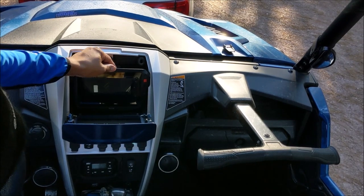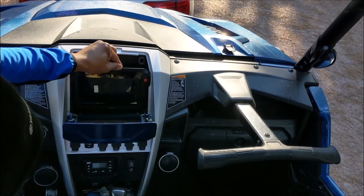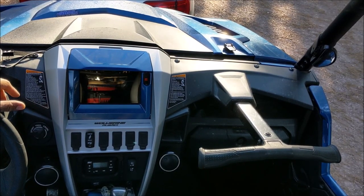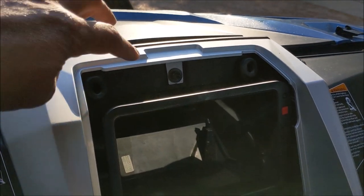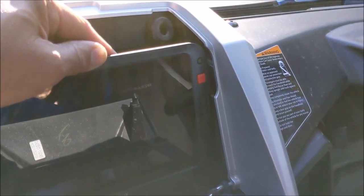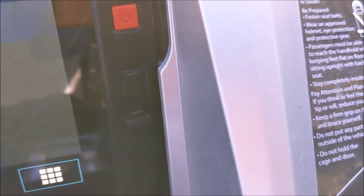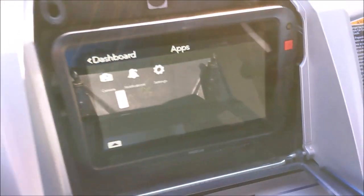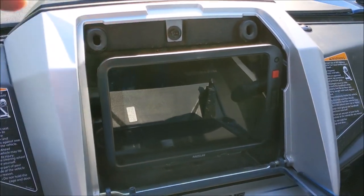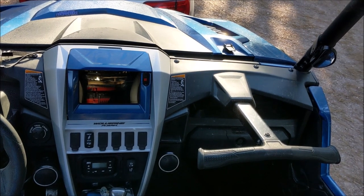See how easy that goes in and out. Mine rocks a little bit because I have just a little bit of interference, but I have enough clearance to where it goes in and out easily. And if you do file it, it's covered by the bezel so only you know about it. I just loosened this up, put pressure against the bezel and tightened it, and it gave me enough clearance so it's not rubbing as much as it was. My cradle is easier to install now. Try loosening the bolt, shoving it over, and see if that's enough for you. Those are the tips for today — please like and subscribe, it really helps the channel.